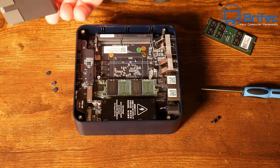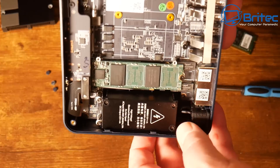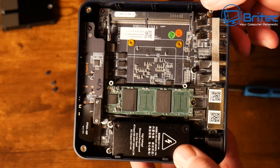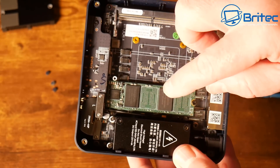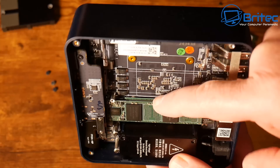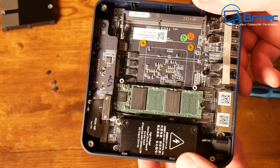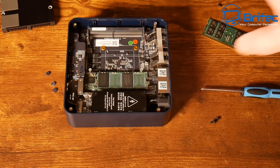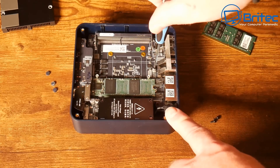It comes with an optional 500GB drive, and supports a maximum of four terabytes of storage in the second slot. You can also replace the existing drive with a larger one. Underneath there may also be the Wi-Fi card — dual-band Wi-Fi 6 on the Intel AX101 — and Bluetooth 5.2 is supported as well.